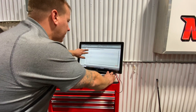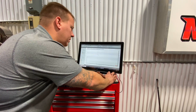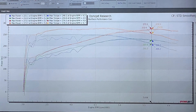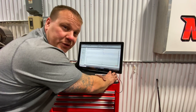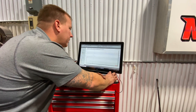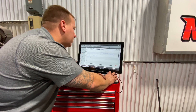As you can see these two lines all the way through the curve — 30 to 40 foot pounds of torque all the way up. Literally carried peak torque at 4,700 RPM. That's a substantial gain, just power everywhere. And that's why I love the Truck Norris — the seat-of-the-pants feel. Most other cams, you're not going to really start to excel until four grand. With this one, basically from two grand and up, it really starts to pick up.